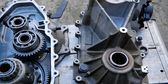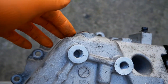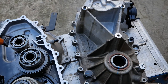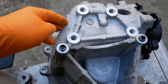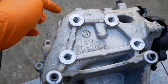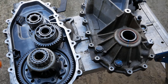The only difference between a 38 and a 28 is there are a couple of mounting points — up here on the top of the casing there are two extra mounting holes on a 38 kilowatt hour Ioniq. I have a feeling that's for the additional water pump for battery cooling, and those two mounting points aren't molded into the case on the 28s. However, you can put a 38 kilowatt hour gearbox in a 28, but you couldn't really put a 28 in a 38 because you'd be missing those two holes. The gearbox internals are identical on both.